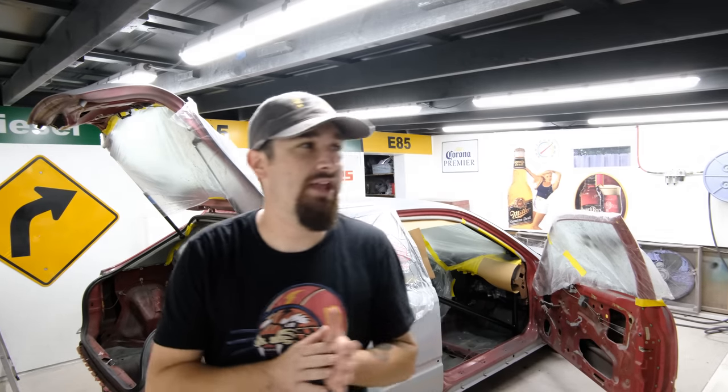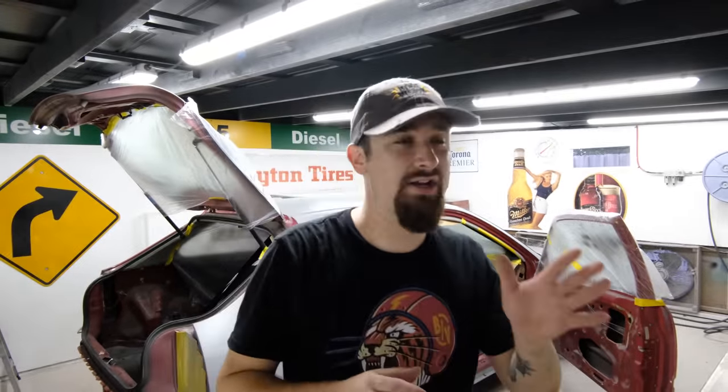The best thing that I could recommend if you are going to be painting a cage is gun control. You want to dial in that spray nozzle. The way that I look at it is I kind of wanted it to look like a spray can pattern, if that makes any sense. Kind of a really tight fan.